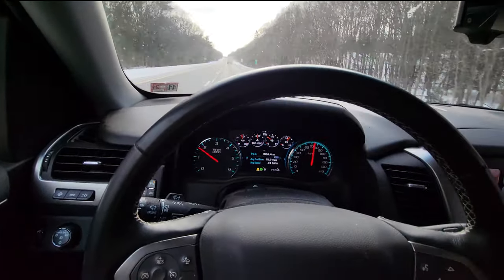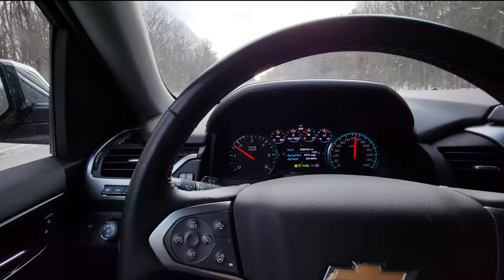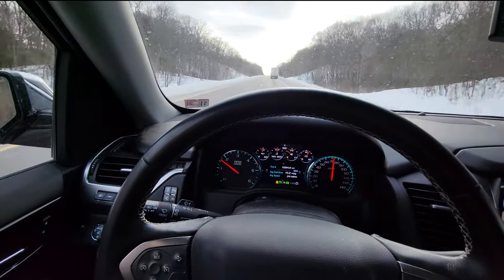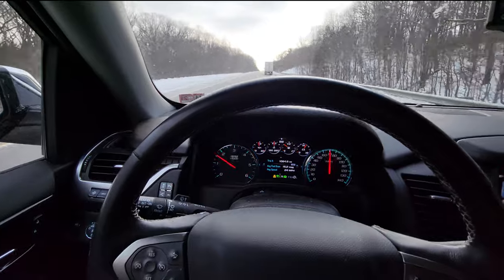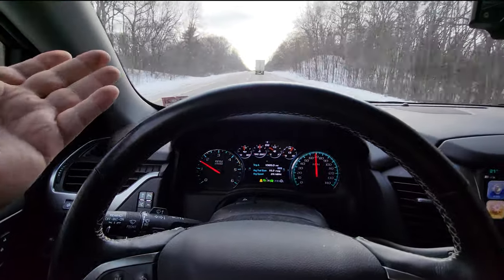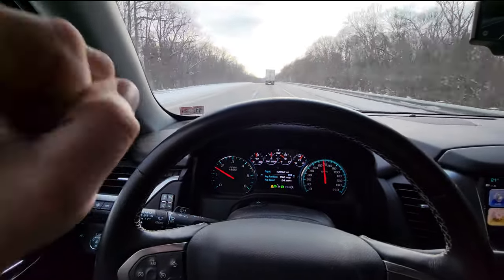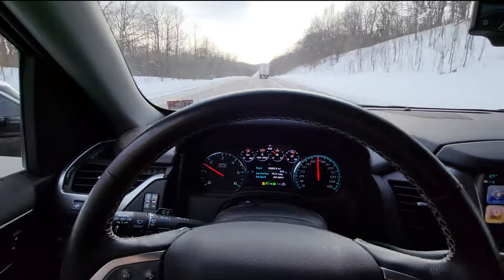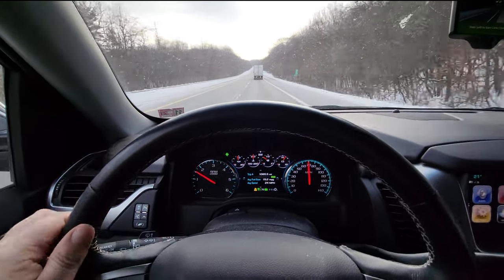Adaptive cruise is not being done by this system on this particular platform. So I realized I didn't finish. It has a front-facing camera that sends steering commands and the emergency braking commands, and it does the auto headlights and stuff. But it also does use radar, just like the more traditional cars, but that radar is a self-contained unit that does not share its radar data. It just sends gas and brake commands. Well, I talked to comma, and in that case where you don't have radar points, you let the car do the adaptive cruise, and that is a supported configuration, believe it or not.